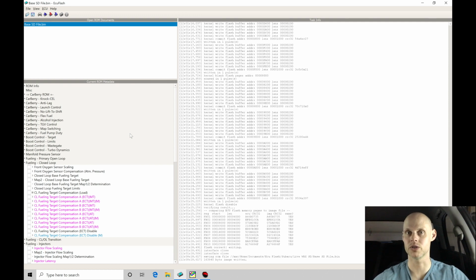What we're trying to focus on and optimize in this training tutorial is the fuel calibration process. Now, we always want to tune the fuel first, then spark timing, then boost control, in that order of operations on our Subaru. By having low spark timing and low boost, we can make sure that we don't damage the engine in the fuel calibration process, or that it's a very unlikely situation where we could. Now, anything can happen, but having ultra conservative timing and low boost will make sure that we're trying to eliminate as many variables as possible.